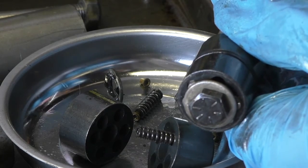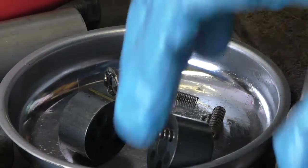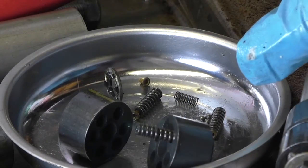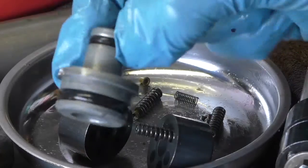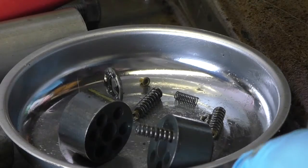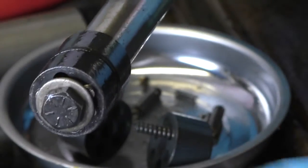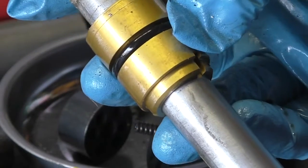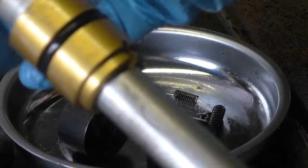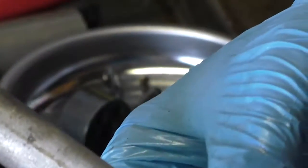Sounds simple. It's very frustrating, but when you're done, hopefully you'll have a set of trim cylinders that work. Again, the main components: the guide bushing, the directing valve, piston rod and shaft with the piston, the guide bushing, and before you put anything together, remember to put this end cap on, guys, because it has to screw onto the cylinder.